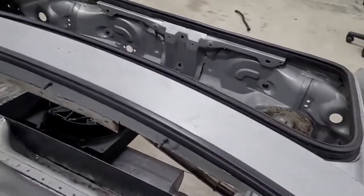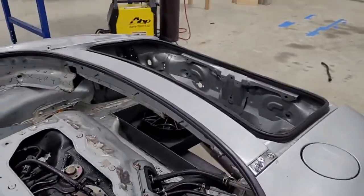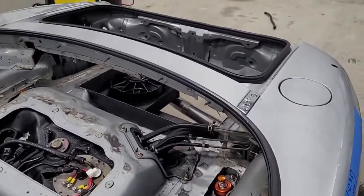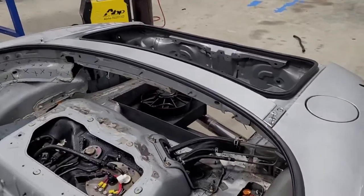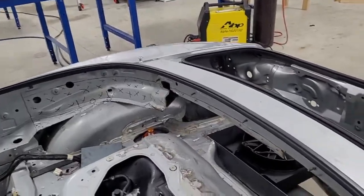Right now this is not going to show up on video, but okay, it kind of does — that moves and shakes. It lost 90% of its stiffness by doing all this cutting, which doesn't surprise me. But we're going to get some of that back. I don't know if we'll get all of it back, but we'll get some by boxing it in as a beam. And we're probably going to put a little bit of bracing here and there.